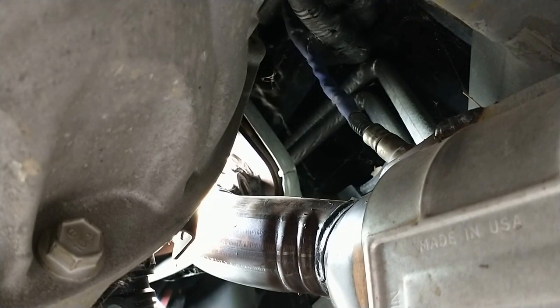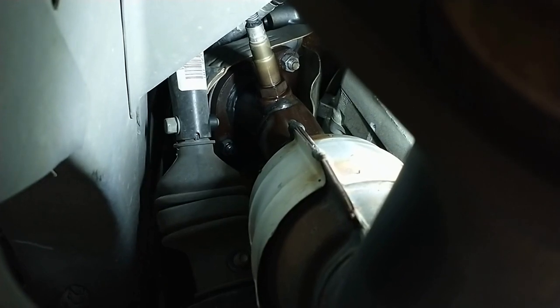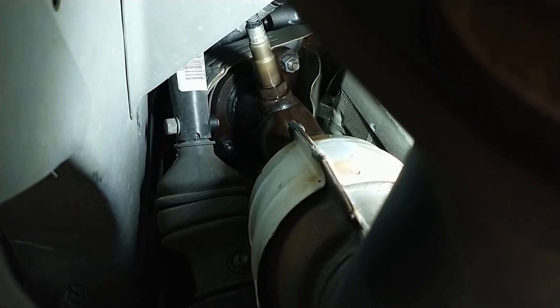Can't really grab anything else from down here, so where we need to go now is up on top and see if we can't get on the passenger side above this, remove that heat shield, and get to those bolts that are protruding down from above. This is the driver's side catalytic converter to exhaust manifold mount and we've got our oxygen sensor up here too. I'm going to try and remove those nuts from down here. This has been replaced before — I can't tell whether there's a stud or another nut on the other side. We may find as we start to loosen the nut that the bolt itself may just start spinning, so we may have to get up top. We'll see what they put in there last time.